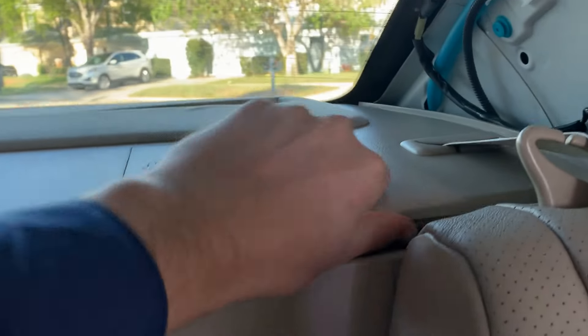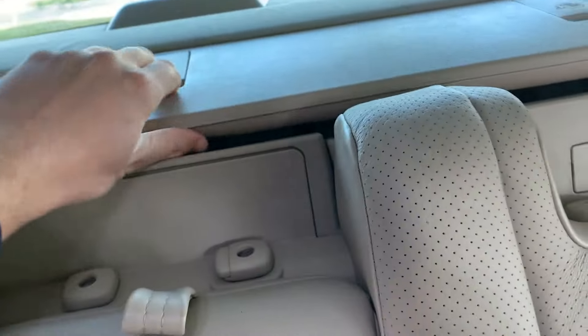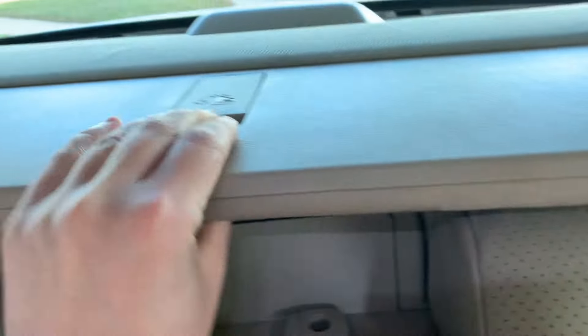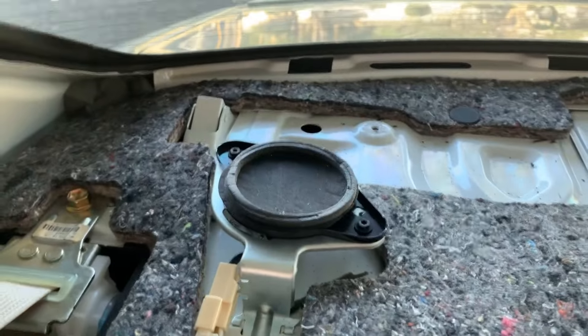Now you're ready to lift up your rear deck. On the driver's side, lift up until you hear a pop. Do this again on the passenger's side. Now grab each side with one hand and lift up and towards the front of the car. Then slide the front edge of the rear deck towards your seatbelt buckles. The rear deck will need to rest against your seatbacks. The underside has some sharp plastic parts, so you may want to put a towel between it and the seats to protect your leather. You'll be leaning against it during most of your repairs.